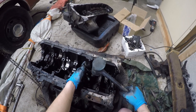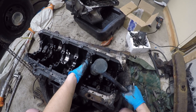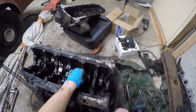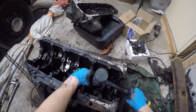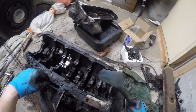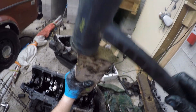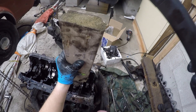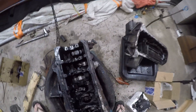Here we go — pounding out piston number 5, just using a soft mallet. It is after all just aluminum. And it plopped down there pretty far. I reassembled the connecting rod a little bit — I didn't want to be hammering on the studs like I did before. And I think that's about as deep as it's going to go. It doesn't quite stick out the bottom — so here's my punch, air quotes — the only piece of soft wood that I've got in the whole workshop. Everything else is a metal punch. And there we go, plopped all the way down onto the ground.